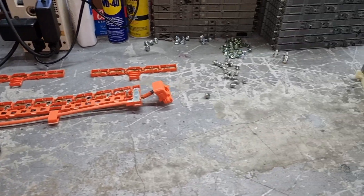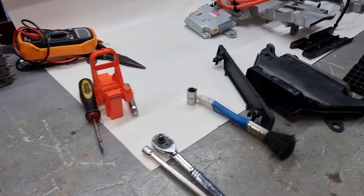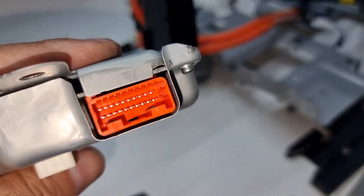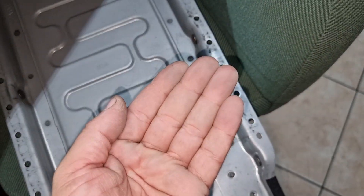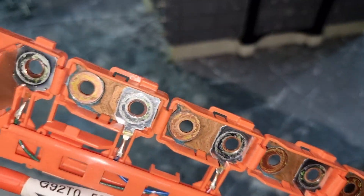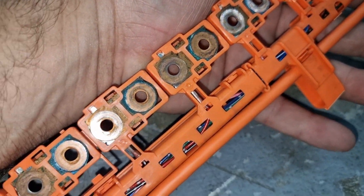We have completely disassembled the hybrid battery from this 2015 Toyota Fielder. The inlet is a mess — the cooling fan net is clean, however the blades are not so good. The good news: I didn't find any corrosion in the pins of the management unit — that is a great thing. The housing is pretty dirty, a lot of dust. Looking at the connecting lugs — we've got some corrosion, so we're definitely going to change these connecting lugs.